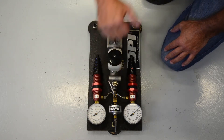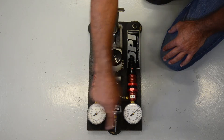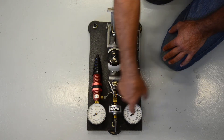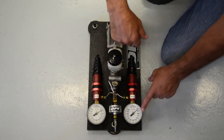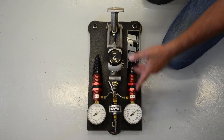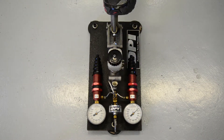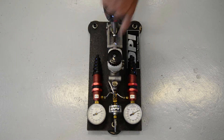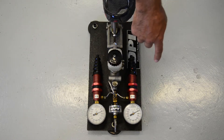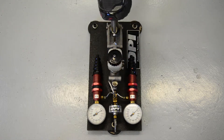And if you'll notice when I click this a few times, the gauge will delay a little bit compared to the front. But yet when you let off the brake pedal, it comes back just as fast as your front. So here I go, I'm going to show you how this works. As you can tell, the front is going up to your specs and the rear just takes a moment to catch up.